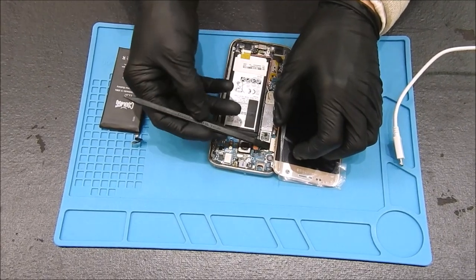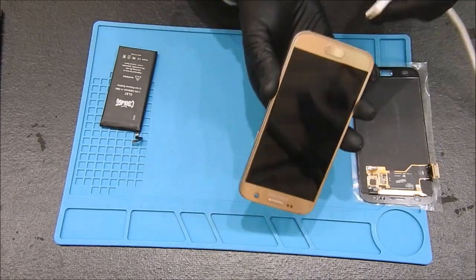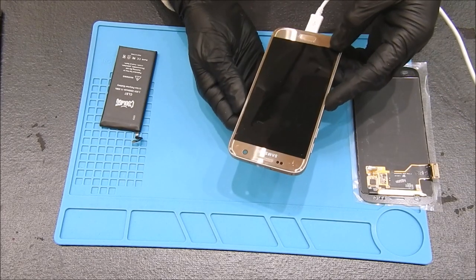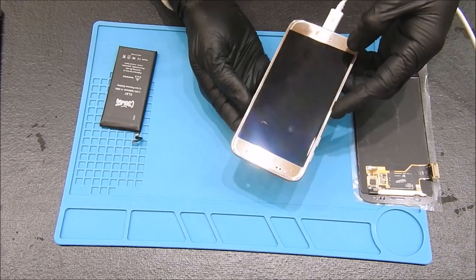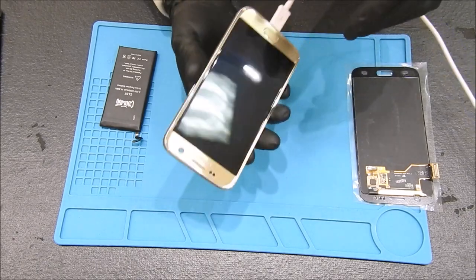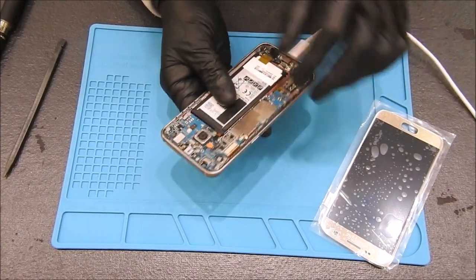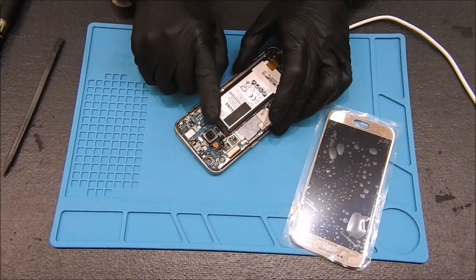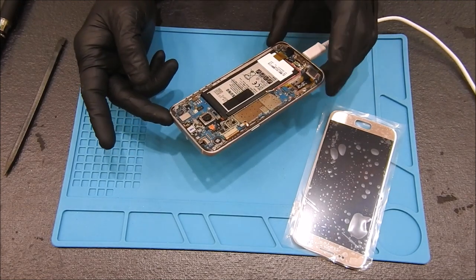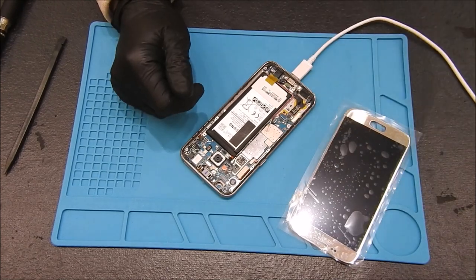I'm hoping we don't have to put a new screen on this. Original everything now, with the new chip. Yeah, that screen is bad — that sucks. Still taking a good charge and there's our blue light. Alright, so we know now that it is fixed, and we need to put a new screen on this to finish up the repair. The repair was for the MAX chip, which is somehow tied to image on Galaxy S7s — seems to be the one to replace when you have no image and can confirm the phone is booting. Thanks for watching, and we'll see you on the next repair.